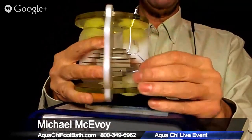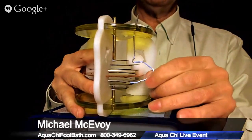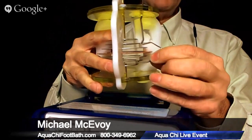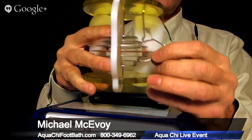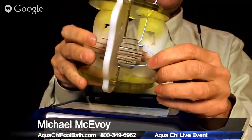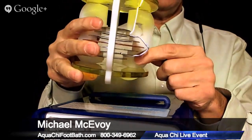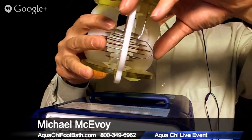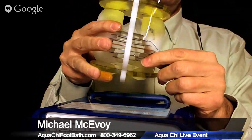The other thing that can happen is that this clip can be installed the wrong way. Let's say I didn't have it quite installed on the rings. Well, it can touch other rings on the module, and that can create a condition where it causes a short. Okay, let me put it back on. Now this is properly installed. It's hugging the two rings that slide in and out of the module, and it's not touching any other rings. If I wanted to manhandle this, I could push this in so it will touch another ring, but there's no need to do that. As long as you have it installed properly, it's not going to blow a fuse or create a short.